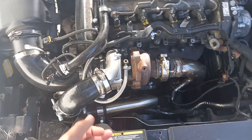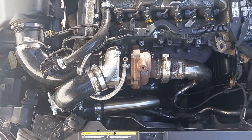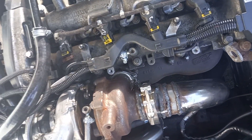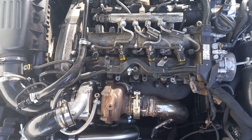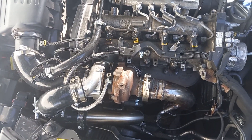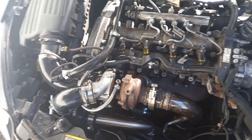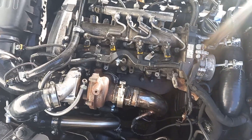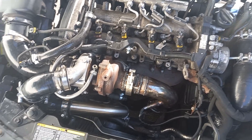The oil feed is a custom line which runs from the normal place on the Insignia straight into the turbo itself. We had to weld a V-band onto the turbo, which you can see there, and another V-band was welded onto the standard manifold at the very bottom. The standard manifold had to be taken out and ground out a little bit, because this particular turbo — off a 2019 BMW — had a much larger inlet than the hole in the standard Insignia manifold. Both engines are two-litre, so it was simply a case of making that hole slightly larger before welding the V-band on. We also cleaned up the inside of the manifold a bit, removing some casting marks and generally improving on the rather poor factory finish.